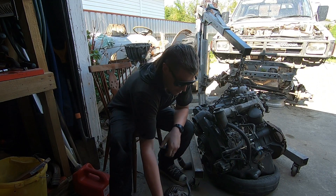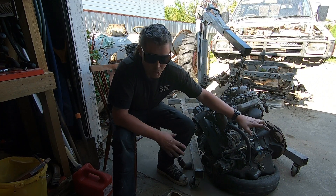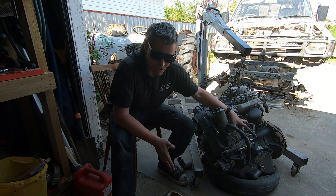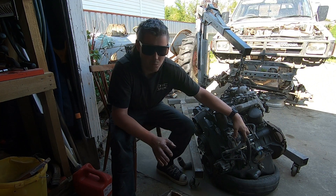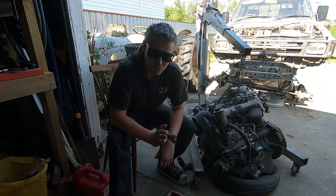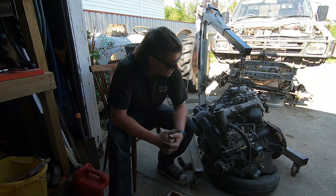With no other electrical aids whatsoever. The injector pump on this is a bit smarter — it's got several plugs all over it and it is ECU driven, so without an ECU and a wiring loom running to that injector pump there's no way we can get this 1KZ going. We're going to be submarining this truck deep underwater. Electrics and ECUs — cut that out. This injector pump will be full mechanical. We'll be able to go completely submerged, and as long as it's got a 12 volt signal to that fuel solenoid this thing will keep on chugging, as long as I've got clean air going to it through a snorkel.